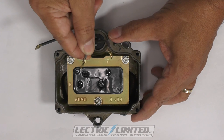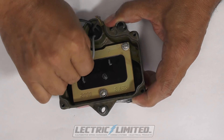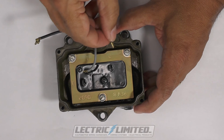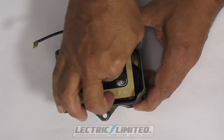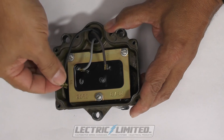In regards to the color codes for each of the three wires to be connected and to which terminal on the module they connect to, refer to the installation instructions for your application. In this example, we'll connect the gray wire to terminal 1, the brown wire to terminal 2, and the black wire to terminal 3.